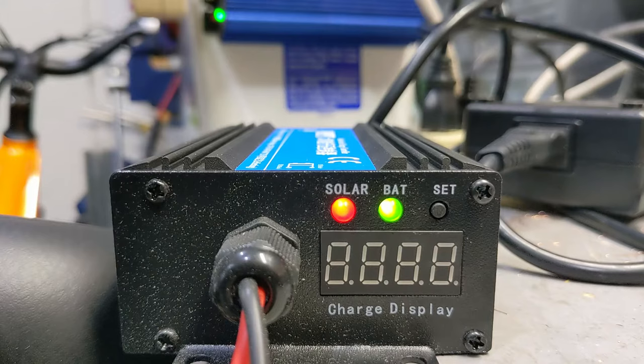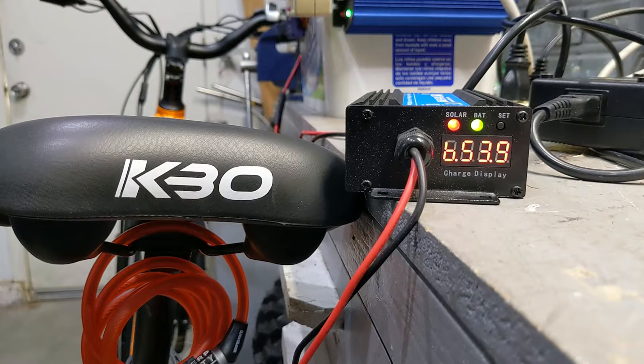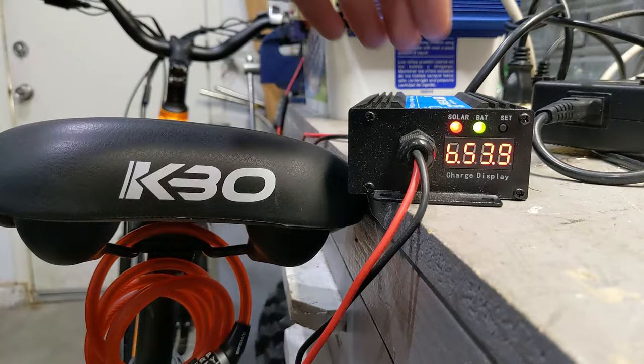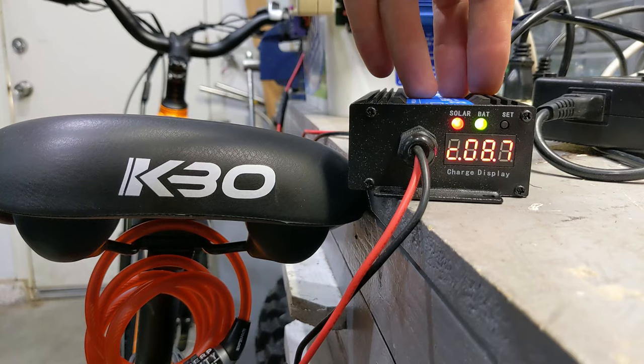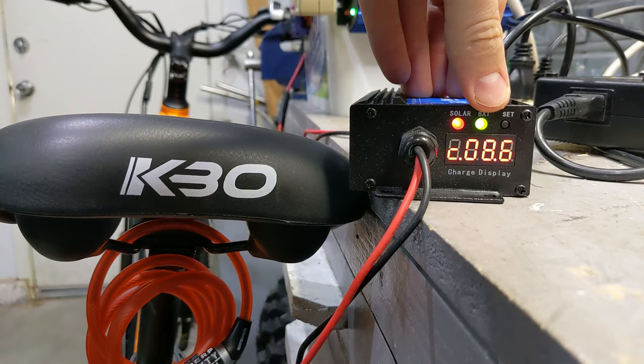If you put 200 watts worth of panels, it'll charge at 200 watts. The original controller on the bike charges between 120 to 170 watts, so the battery can take 200 watts. If you want to charge faster, there are faster chargers, but it can reduce the life of the battery — I'd recommend not to overdo it. 200-watt solar panels will be more than enough. You could rush it if you're in the middle of nowhere and need to charge and go riding — once or twice won't break the battery. This unit will stop automatically when it reaches 54.6, which is why we set it to self mode. Very simple setup.